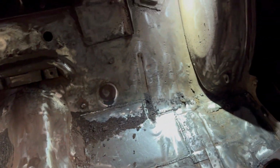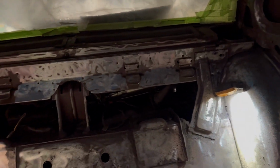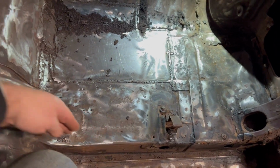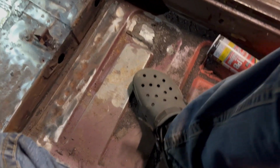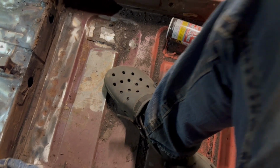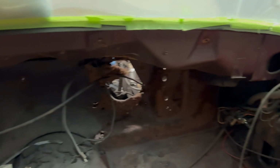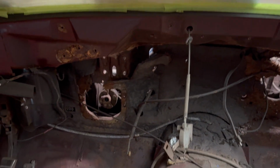That's the plan. I got some cleaning to do before I call it a night. Get the vacuum in here, try to wipe this down, and if I feel like it's clean enough, I'll go ahead and start some rust treatment tonight. Have it ready, put a coat of primer at least up to here, and then I'll finish grinding this rear floor pan area. That's not much. And tomorrow, finish getting these few things off the firewall and clean up the firewall.